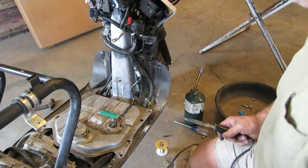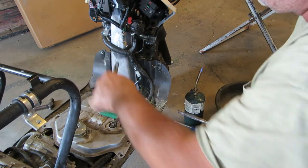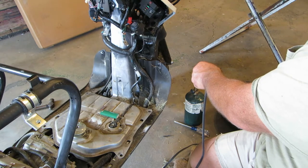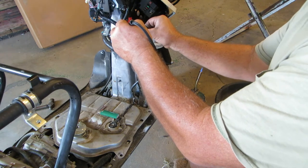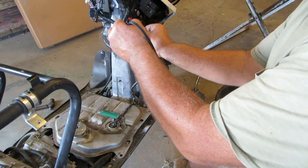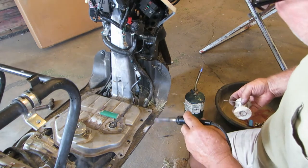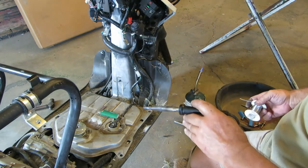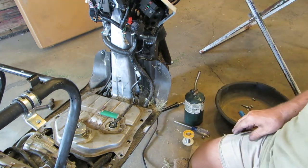Now, you're not gonna believe that, but that's gonna be hot. Oh, I get the other side. Look at that. Get the other side. Sometimes you solder something and you flip over on the other side and the wire's not tinned up good. I like to tin both sides, make sure everything's okay. Even though it's a terrible solder job, it's all tinned really good and it won't come apart.